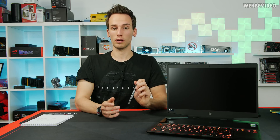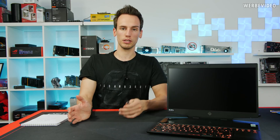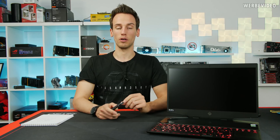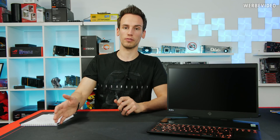We have 32GB of memory in here. Also quite interesting is that we have two M.2 drives — one terabyte each. Crystal DiskMark shows about 3200 MB/s read and about 2800 MB/s write, which could be higher considering it's two M.2 drives in RAID 0. Always keep in mind with RAID 0 that if one drive fails, all data from both drives is gone.